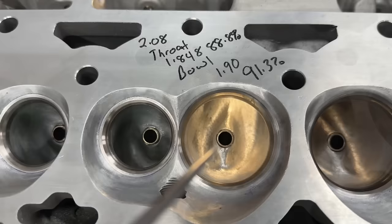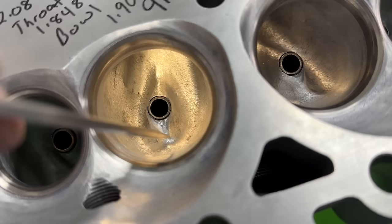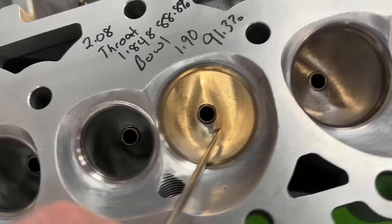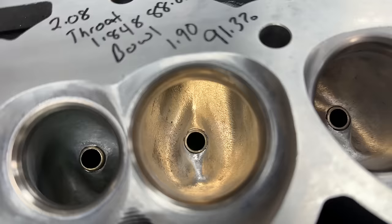Back to his head - he didn't remove the center ring, he left the entire center ring. He could have actually removed more of the aluminum on each side of the vein, which will help fuel from pooling there and bring it this way. It also looks like when you're grinding, you had your burr aimed too far this way, because I can see how it's angled. You should have kept cutting more here to get that centered. You could have easily done that - if you had the burr, you could just hit this side right here and get that better angle in. That's just me being a little critical to help you out.